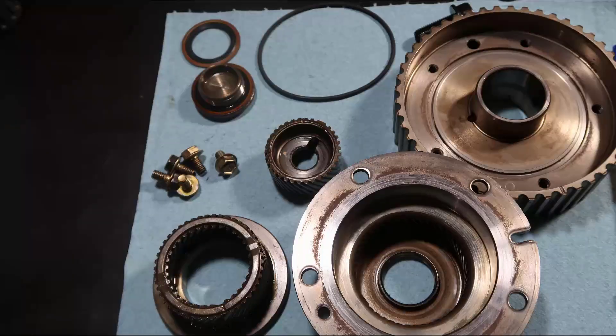I rebuilt the VVTi gear. If those gaskets fail, you're going to have oil leaking. I used purple arrows to show where I marked — a sharp tool to make marks, shown by the green arrows. Those marks will guarantee that when I put it back together it'll be aligned, matching the laser alignment done at the factory.